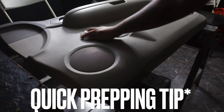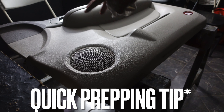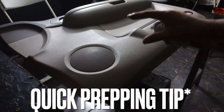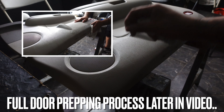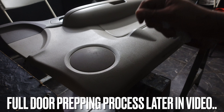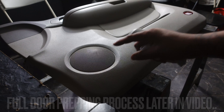When we go to clean, you have to make sure you clean the surface and the sides as well, because pretty much everything needs to get protected on the door panel when we tape before we do fiberglass work. Fiberglass can get pretty messy and it's actually rather hard to get off — it probably won't even come off. You got to make sure your tape is thick so you can lay a good, decent amount of layers down to protect your door panel and get the best results from your fiberglass mold.